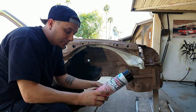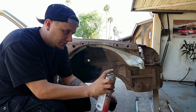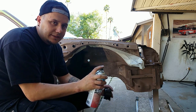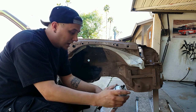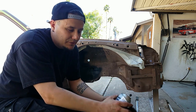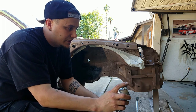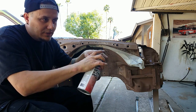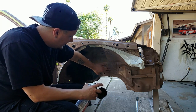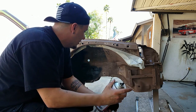I've never personally used this stuff myself. The guy at Old School explained to me that it comes out really thick. The closer you get, it leaves a really thick coat. The farther away you get, you get more of that splattered texture look. What I'm going to try to do - because I only bought one can and I'd like to do all four wheel wells - is do a really heavy coat first, and then after that kind of sets up, come back a little farther away and leave a splattered texture over the top. So we have a nice thick protective layer and it's going to help fill in a lot of the cracking in the factory undercoating and give it a cleaner look. Let's give it a try and see how it comes out.